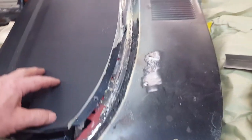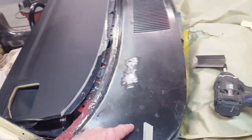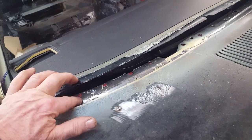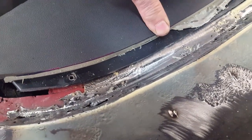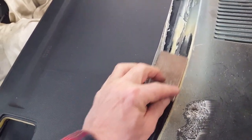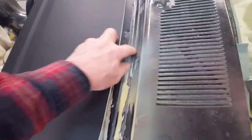I think I've gone as far as I dare with this mock-up cowl. I'm getting pretty close to the final trim on all of this stuff, so I need to complete the cowl area, get the vent made that seals up the underside, and get going. You can see how much higher the dash wants to ride — that's how much we're bringing it down in the front to roll it into this old car's dashboard bed. I took a little piece of metal, bent it up to the angle of the windshield, set it right in there, and trimmed along it with my knife.